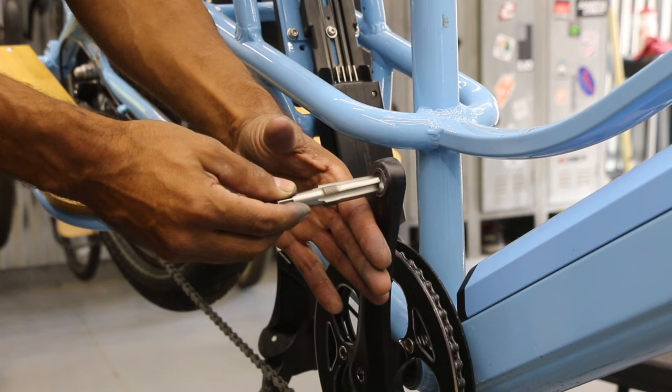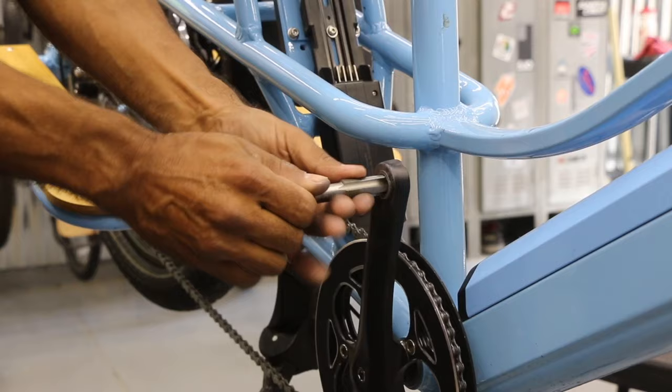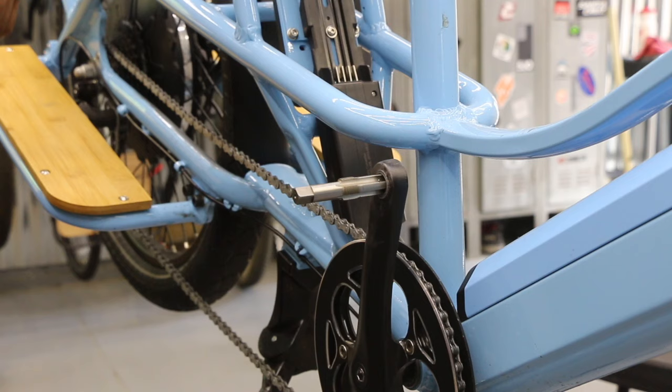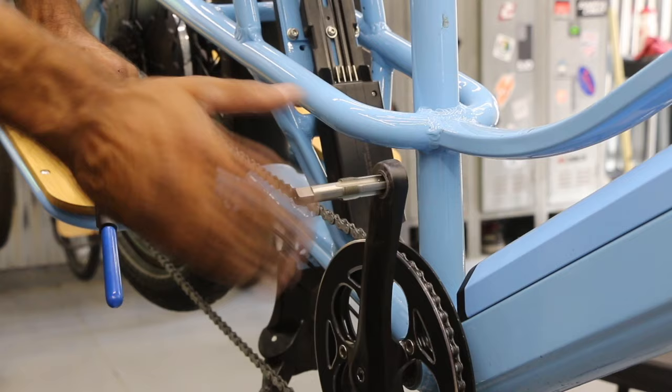Always stand back and take a look because it's hard to see if you're tilted down or tilted sideways. Push it in flush, get it started with fingers to at least get it kind of stuck in there, then take a look back to make sure it's not tilted. Once you've established it's nice and straight, you can continue to turn. You could use a wrench, but I prefer a Park Tool TH-2 — basically a T-handle that helps you keep a nice even turn.